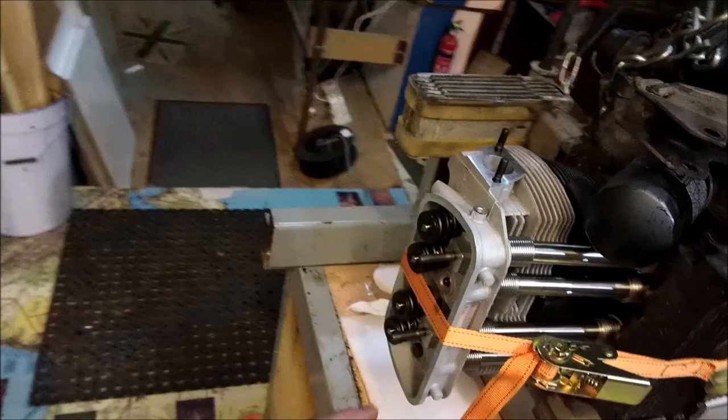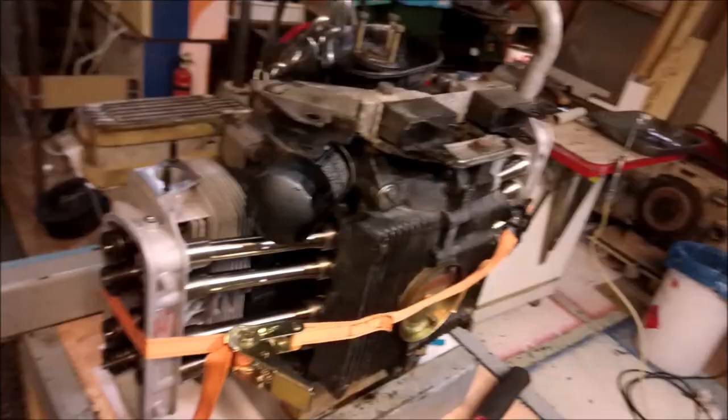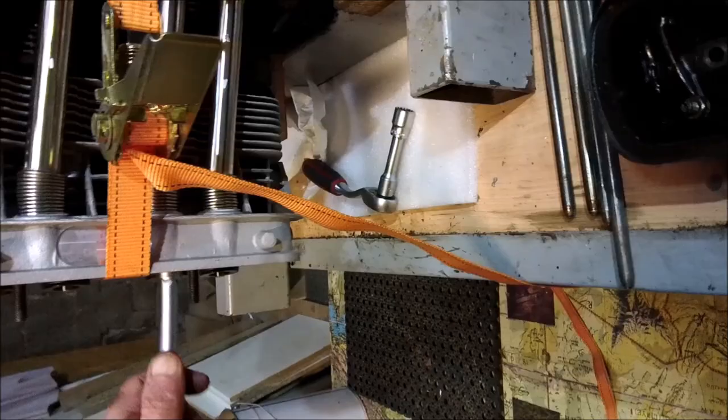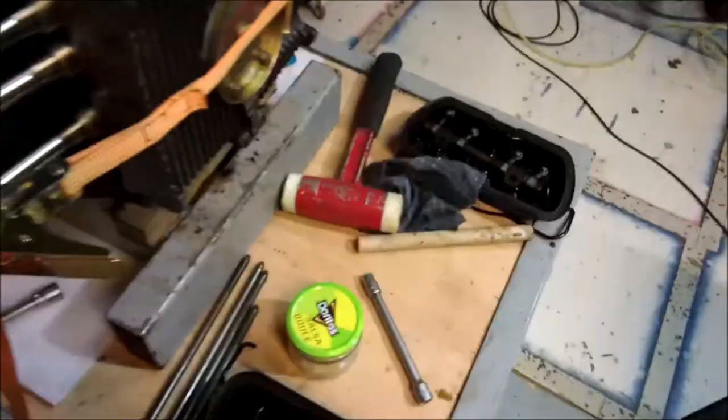So now I've got four nuts caught, only just, I can't actually get the washers on. So you tighten progressively until you can get a nut with a washer at all four corners, as it were, and that you're happy with the way everything is settling down. All right, and then you can get all the nuts on, start to nip it up. Don't try and torque it down yet, we're not there yet, things to do yet.